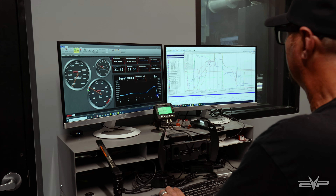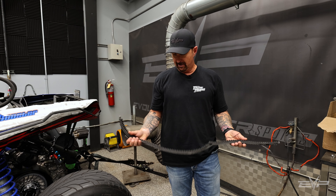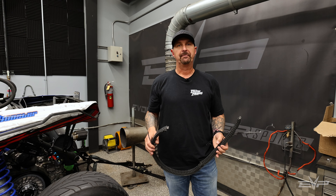A lot of less expensive belts are knife cut, and what happens is they're not as true as one that's been buffed to the right dimensions. The only disadvantage is it leaves a little bit of haze, and sometimes there's a little bit of cord that bulges out slightly. But as soon as you run it, everything is proper on it. The EVP Badass series belt — the world's best belt — I know this belt will last between 75 and 100 pulls on the dyno at 450 horsepower, no problem. I'd be surprised if this fake belt lasts five pulls, but we're going to find out.